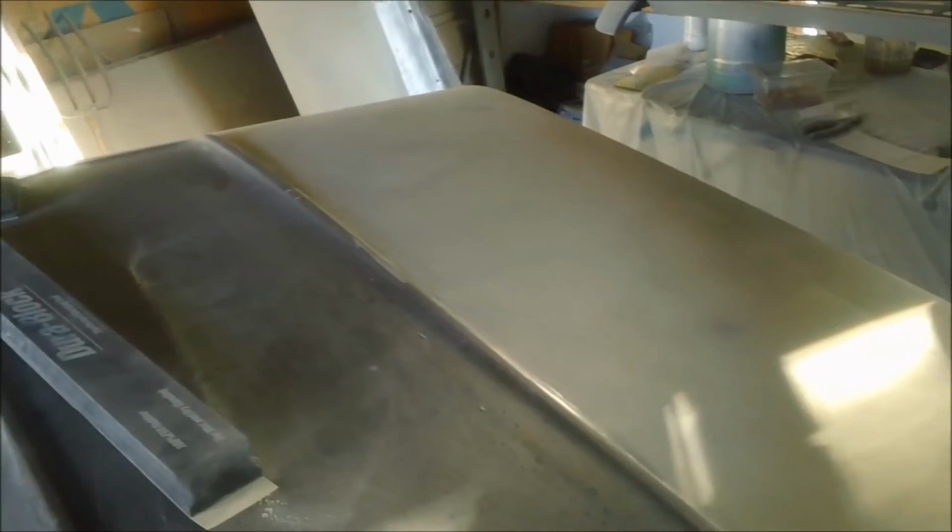Okay, so after about 40 minutes of just blocking this stuff, man, it sounds like concrete right now. Got everything kind of roughly feathered in, and like usual, there's a couple little whoop-de-doos with the U-pole filler when you use it in a large spread like this. Some pinholes. Probably some glaze in there, and then probably do another really thin wipe, hit it with 80, and then it'll be ready for a coat of epoxy sealer and then some poly for another blocking session. But this thing is now straighter than what it was out of the factory.